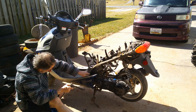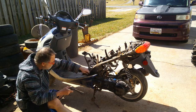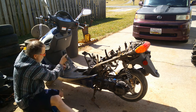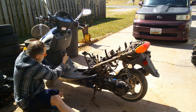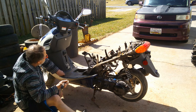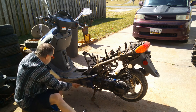If you get down in this part while tearing it apart and it looks like the battery tray or this piece of plastic is split — look how long that is — it's best to get that somewhere used or fix it before you start putting it back together, because you're going to have extra time when you put it back together. That'd be like putting a whole engine together in the car then finding out the oil pump's bad. Might as well do it while you can.